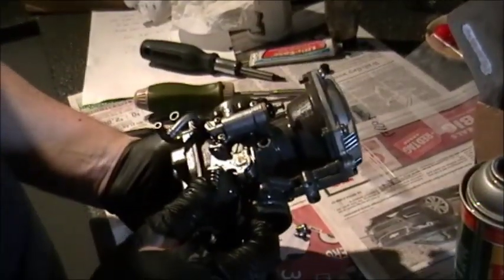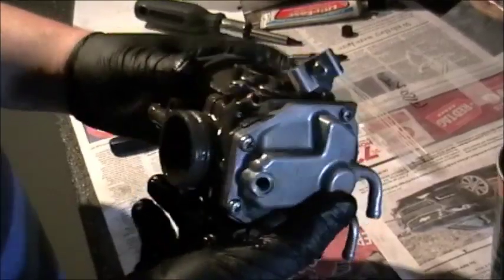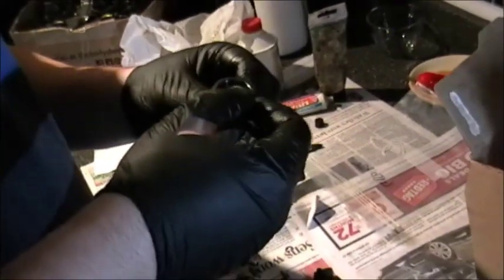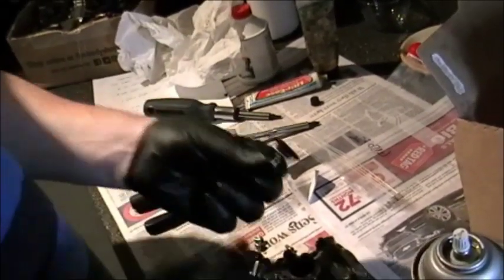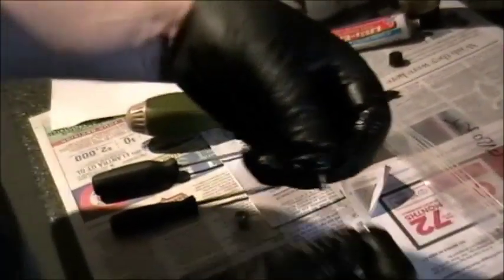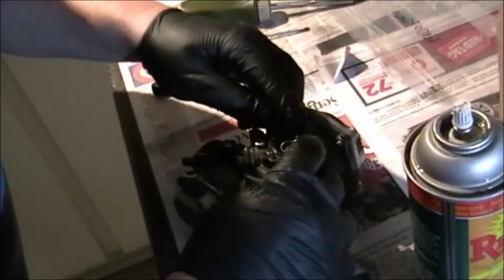She's pretty clean and turned out real nice. I like the process we're using. There's just a little bit of flash rust in the odd spot, which I can live with — most of that we can rub off. On this side we've got the air cutoff valve — don't want to forget that. I'll put a little lube in there. That's what the air cutoff valve looks like — about 15 bucks. As you close your throttle, it creates a vacuum and pulls this thing up, opening up a passage in the carburetor that leans out the mixture. It prevents backfire — prevents the bike from going bang when you let off the gas. If your bike likes to bang when you let off the gas, that's probably what's going on — this thing isn't working right.